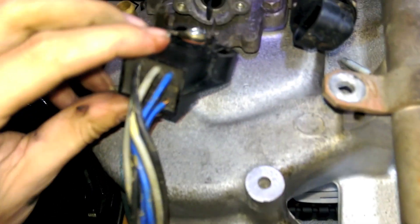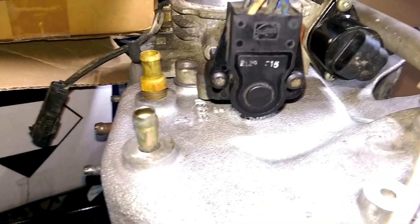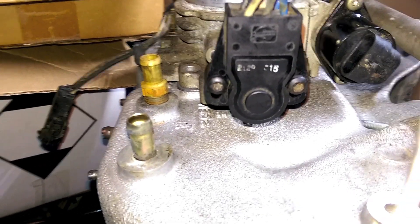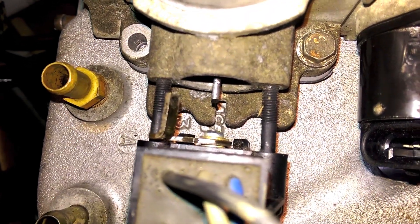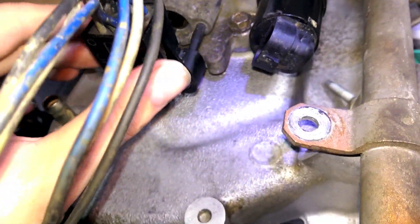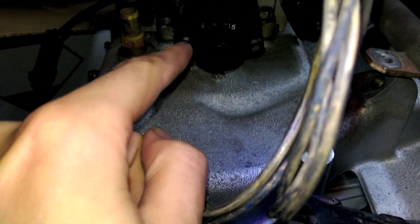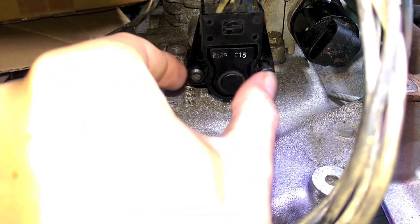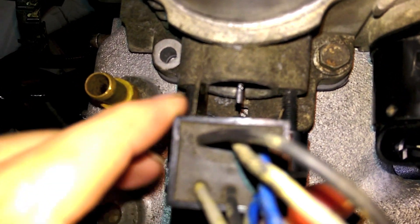You can buy a fancy Hesco adapter that does all the business for you, or you can try and make your own. First thing you've got to figure out for adapting is actually getting the thing to physically fit on here. The bolts are long enough but this one on the right is a little crooked — the TPS doesn't properly align. The holes need to be dremeled on the inside a little so the bolts can come in and properly fit. They're only off by a little bit, so you just have to shave the tiniest bit off to get a proper straight shot.